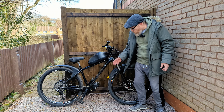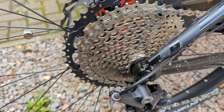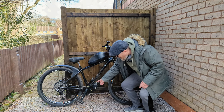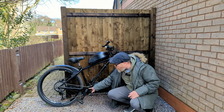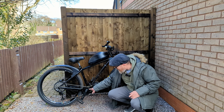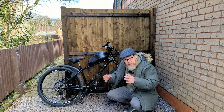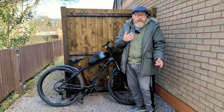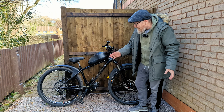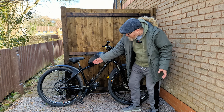Today I'm gonna test how much torque is in the CYC. If you look at the back there you can see I've got a huge cog — I think it's something like a 51 tooth — and I've also gone for the smaller ring gear here. That doesn't make any difference to the top speed but it does make a difference to the amount of pedaling force; it'll be easier to pedal because it's smaller. Because there are two smaller cogs it doesn't affect top speed, but I've got small cogs at the front and big cogs at the back.